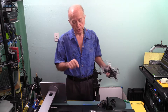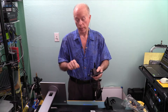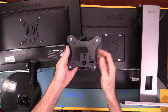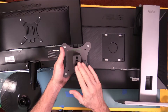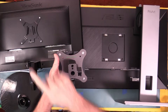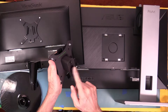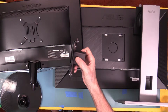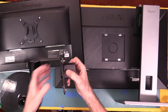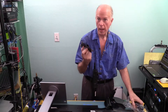Nine Dot Solutions has a couple of different plates. This one is good for VESA mount 75x75 and 100x100, as you can see by the bolt pattern. They also have one called large that'll do a 200x200. So they have both styles, and then of course the tilt adapter. That's a two-piece — one piece like this with no tilt, or with the tilt adapter for two pieces, and the third piece being the quick release. I like those — I use those a lot.